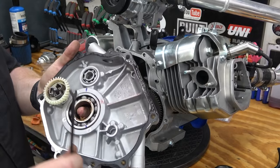So I'm not going to worry about tuning this in until we get our pulleys in the mail. This is a 4-inch pulley, but the belt is sticking in it, making this a 3.5 because it's sitting so far in the pulley. So really, we're running a 1-to-1 ratio. We need to be underdriving this supercharger. So what I'm going to end up doing is buying a bigger pulley for the supercharger, and this won't be an issue because we'll just push it back and run a longer belt. This is basically a 3.5 again because it's sitting in there. I think I'm going to go up to a 4 and then a 4.5 and start playing with it.